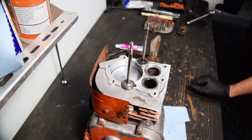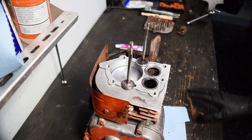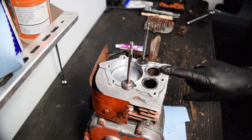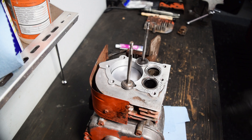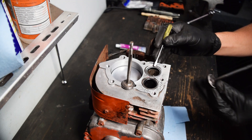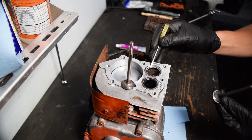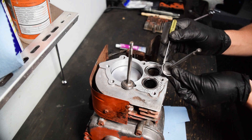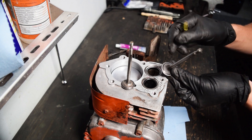I've done a lot of cleaning so far - it's getting there, not exactly where I want it, but it'll do. Got all the mating surfaces cleaned up for the new gaskets, got the piston cleaned up, got the bore cleaned up, got the dirt out of the bore and rings. I lapped one of the valves so far just to show you the difference, and now we're going to do the exhaust port and then slap this back together. If you look at the intake side, there's a nice clean mating surface right there and a very clear band of new mating surface on the valve itself.